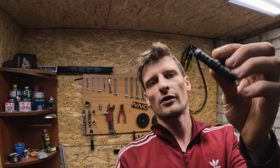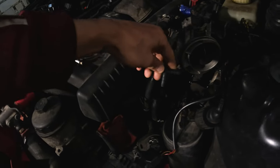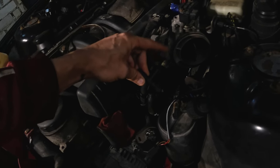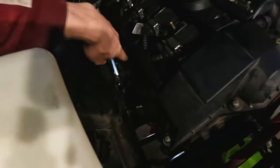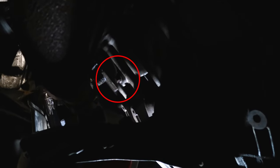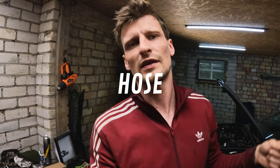For the feed we're going to use those two hoses which are on our throttle body. I bought a connector for it, so the plan is to connect those two hoses with this connector and then connect our brand new hose to this side and go underneath the car. For the return line, there is a bolt — I'll show you — and I would like to replace this bolt with a banjo connection and route it to the other side of our turbocharger. So now I'm going to drain some coolant, then go underneath the car to measure that bolt thread, the size of the feed hose, and the return hose.